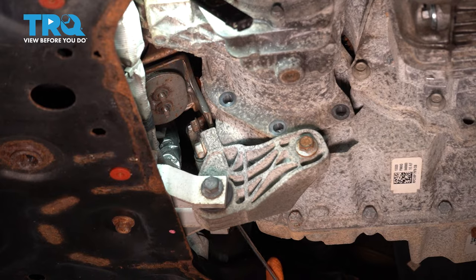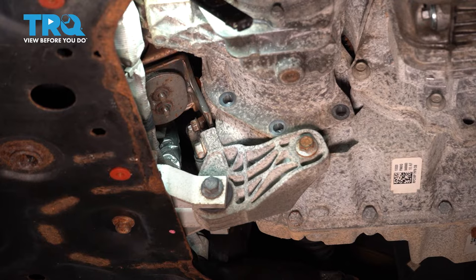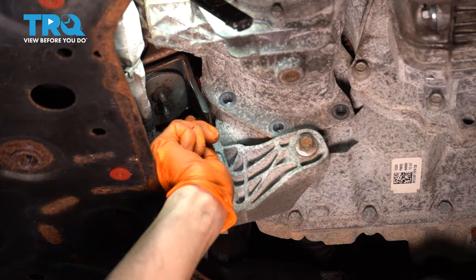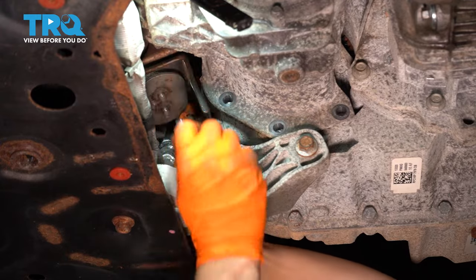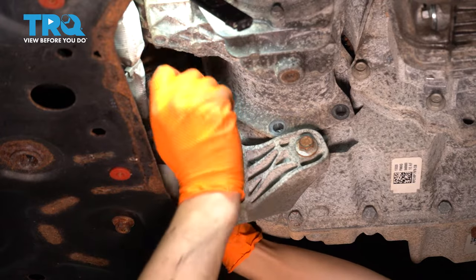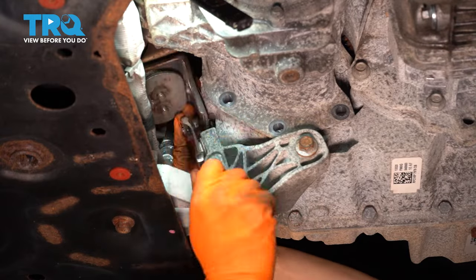So at this point I have two mounting nuts on here, one that I'm holding with a wrench and the other one I'm going to snug up with another wrench. All right, snug those two up. And now what you can do is use the outer one and drive out the whole stud. Basically what's happening is the two nuts are pressing together, locking themselves up against the threads. And when you unthread the nut, instead of unthreading the nut, because there's so much pressure on the threads, it just takes the stud out with it. So there's that.